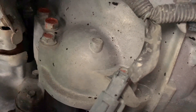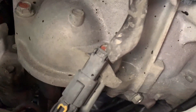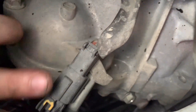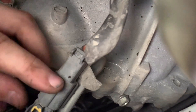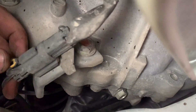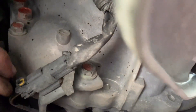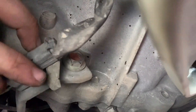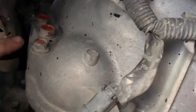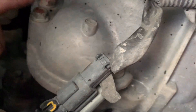Right here are the bolts for the starter. You're gonna want to disconnect this plug — it goes to the starter. Just push down to release it. Note that this area is extremely hot. There's also a bolt holding things on. Those are the only bolts; they're 14 millimeter. Take this off, take this off, and then you'll pull the starter.